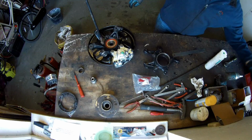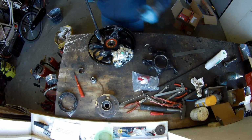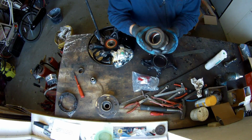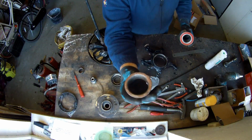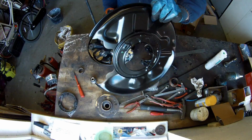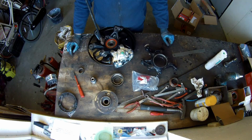The bearing, you can push the centerpiece down, or otherwise the other way around. First you push the bearing in. I always use an old bearing. You can put this on the sides, because you first have to press the complete thing in the housing, otherwise you will break the center. After that you need to push this piece in here, then you need a ring for the underside. That's another old one. I just put it underneath here and then push the centerpiece in. That's how I'm going to do it. And don't forget in between to put this plate on, otherwise we have a problem. You cannot get it over the flange. So I will move the camera to the height of the press and have a look if I can film how that works.